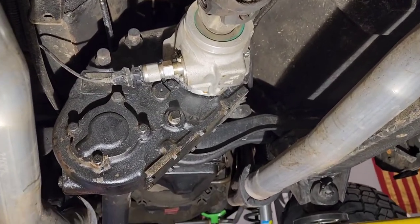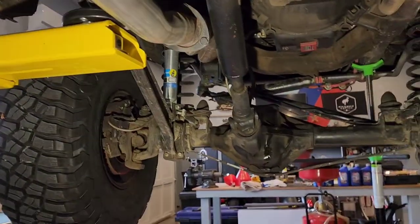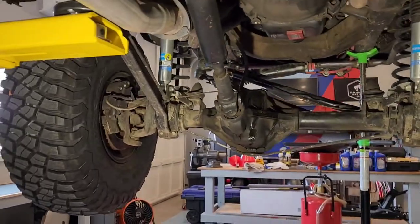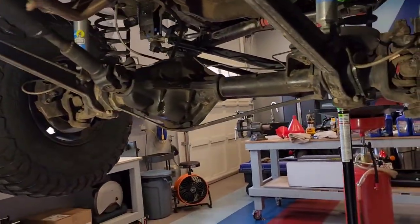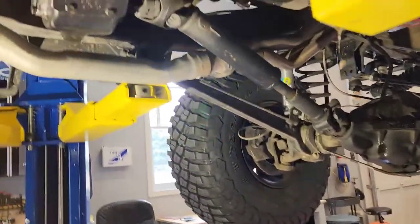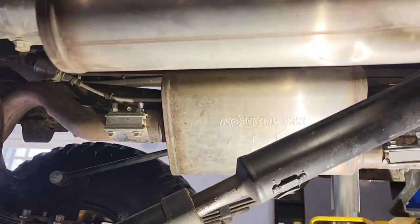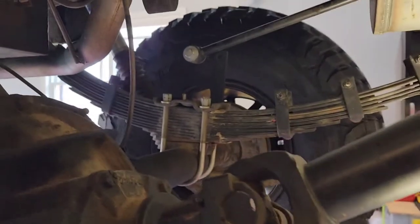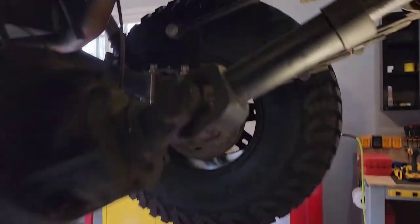It really works well. And then running 7-degree C bushings on a 3.5-inch lift, which gives it really good road manners. And again, that's that Dana 20. And back here is a Ford 9-inch rear end. This thing's running 350 gears, Magnaflow exhaust. Sounds pretty good. Little 302, 11 leaf springs with overrider axle wrap controllers.